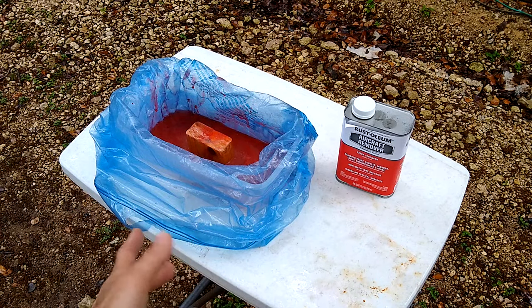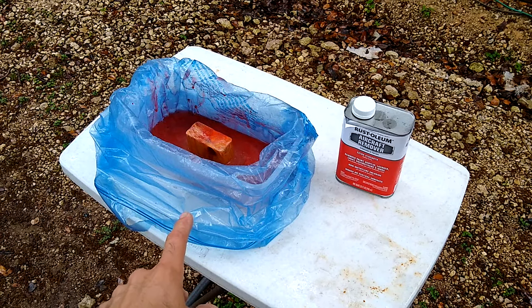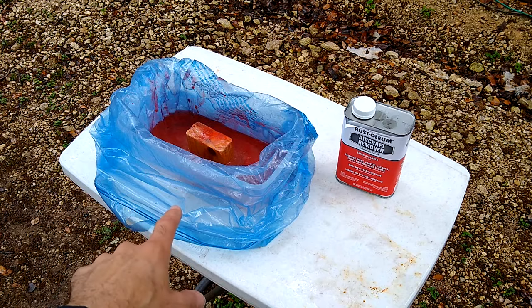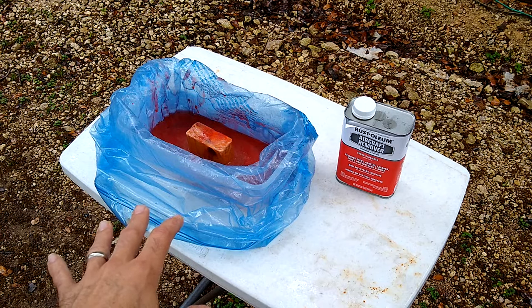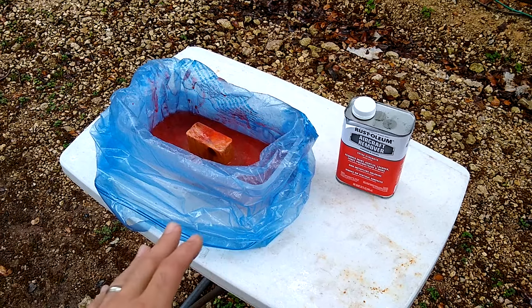They come in a pack of, I believe, 7. Fairly inexpensive. I used the block of wood to just take up interior space. That way I'm not wasting stripper by adding more stripper than I need. Now what I'm going to do is, I've already done one of the front calipers. It's already been sitting overnight. And there's a lot of bubbling. It looks really good. All I'm going to do next is clean it up,